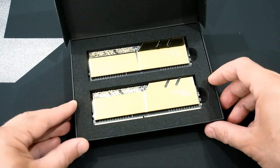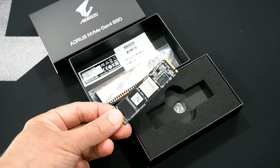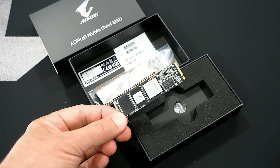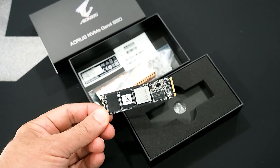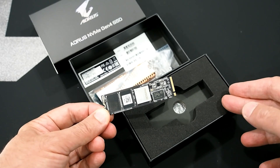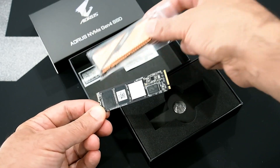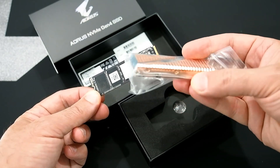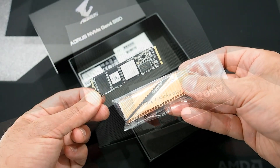Now let me get that SSD open. This is what we had inside that Gigabyte SSD box — it is a Phison-based 2 terabyte NVMe PCIe Gen 4 SSD. These drives are capable of 5 gigabytes per second sequential transfers, which is one of the advantages of the PCIe Gen 4 support on AMD's new platform. These drives were pictured in lots of articles with copper heat sinks installed — it appears to be an option that comes with the necessary hardware, but you don't have to install it.